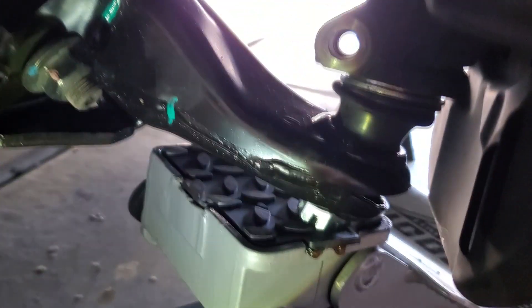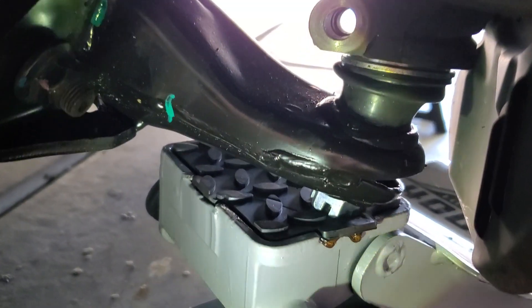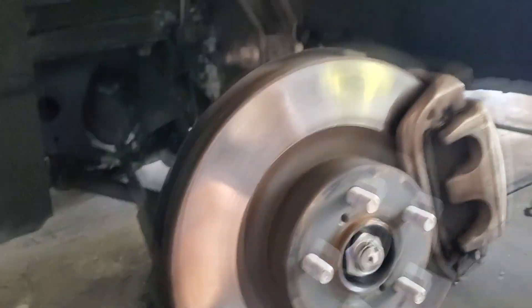Let's see it down here. See how it's pressed in with my jack - it has that little lip. If I can see right there. So all I'm going to do is just take my rubber mallet and just bang right here. And that should bring it down. Yep - see, no more lip. Then I'll put the bolt through there. That way it's in place - I'll just snug it down, and then I'll torque it down to specs.